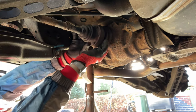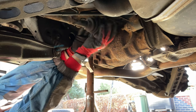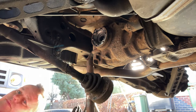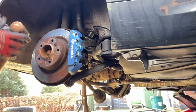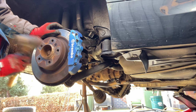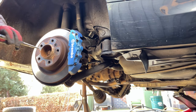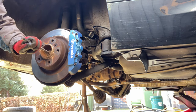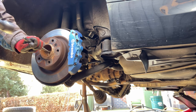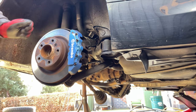This is the easiest side because the exhaust is in the way on the other one. So when we do the second one in a bit, I'll show you how to drop the exhaust down enough to get it out. This will be a bit tight through the splines on the hub — we'll get the copper hammer on it again, give it a tap just to knock it through a bit. Nice big punch, just give it some wallops — that'll soon move. Here it comes. Once it's a bit loosey-goosey, we can just pull it through from the other side.